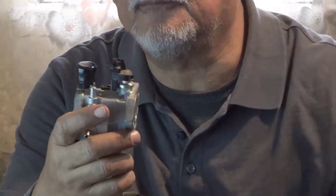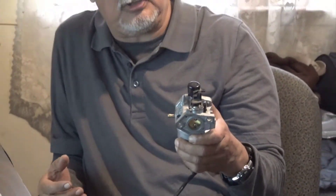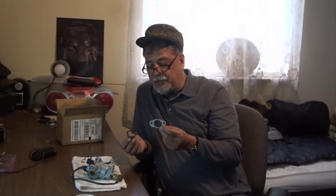Immediately stop whatever you're running — vehicle, engine, motor, generator — and change the oil, because you're close to burning the engine. This carburetor is in good shape; I never ran the generator more than an hour continuously, so it's partly clean. This electronic governor-controlled auto choke is the part that doesn't deal well with gas. Manual ones are easier to convert. If you have a UST 5500 or any copy of the GX 390 or GX 340, look at the picture — the same carburetor kit works.